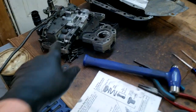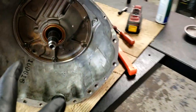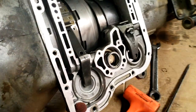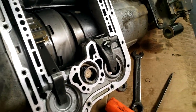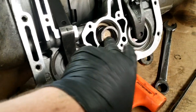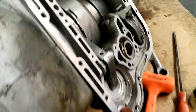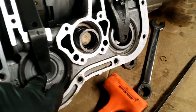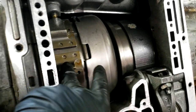A lot of stuff. We've still got some more to go - we've got to do the shift kit for the valve body. But we've got pretty much the transmission back together. We've got a new drum, all new clutches, new band. We already put some of the Transgo shift kit in here - the accumulator seals and new rings and seals for the pistons.